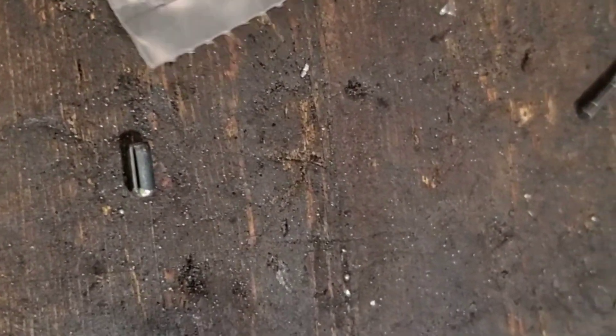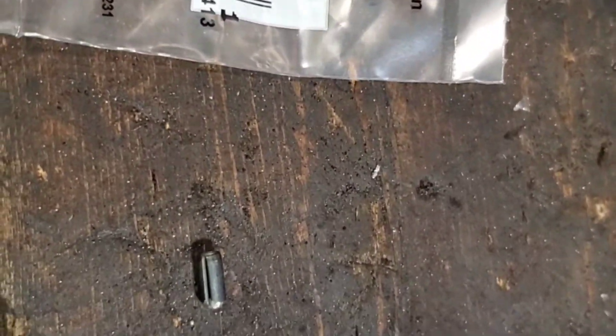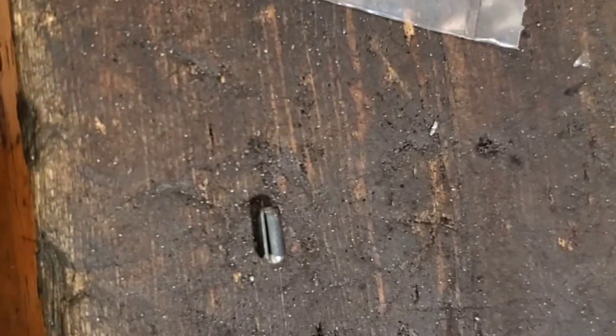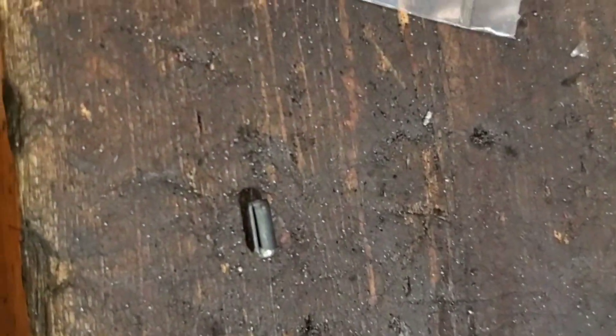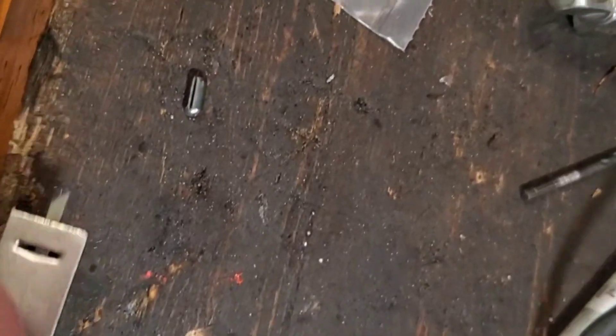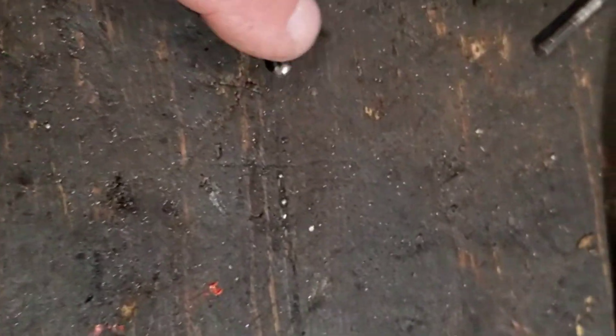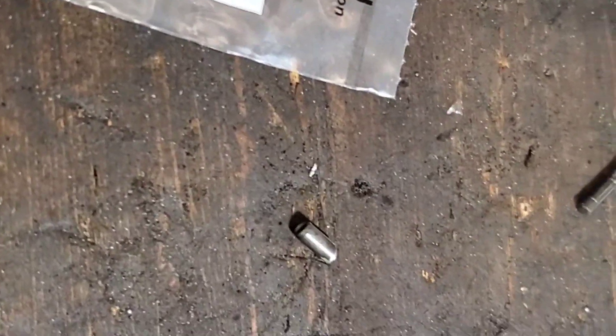Those had some roll pins — actually 5/32nds, but too long. I measured the depth after I extracted what was remaining of the old pin with my caliper, and it's only about 10 millimeters total: 5 millimeters in the crank and 5 millimeters into the pulley. So I had to cut a pin, bevel the edges, and now stick that in the crank and see if we can get this together.